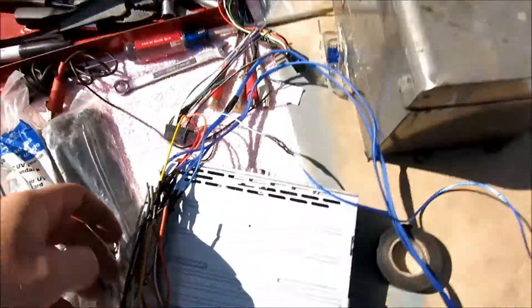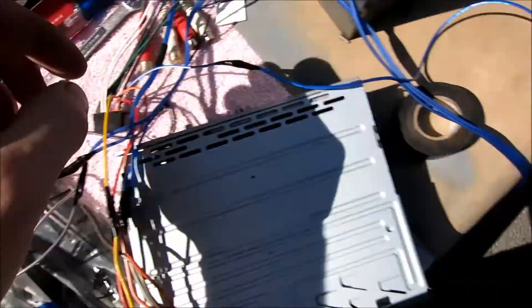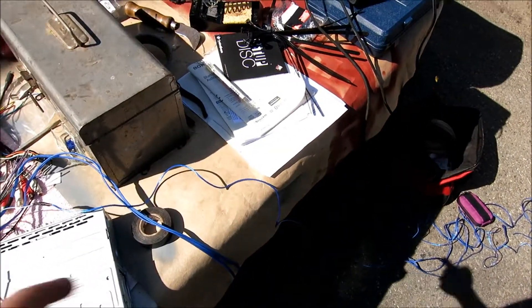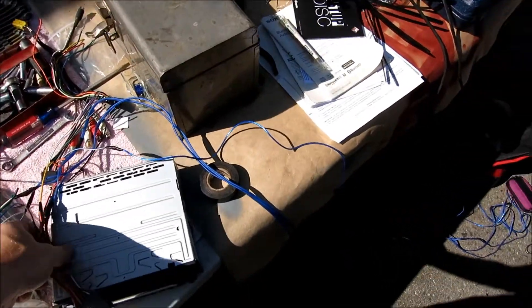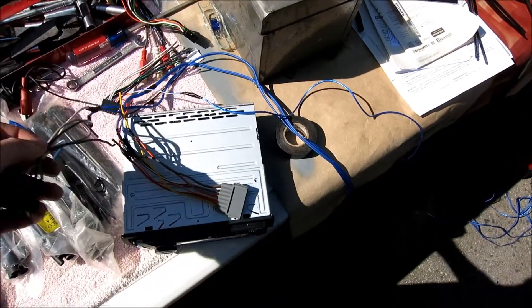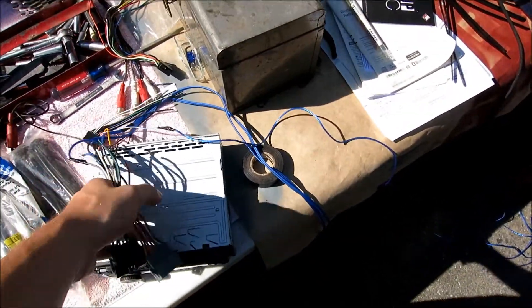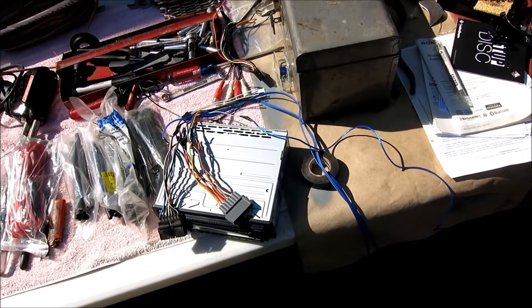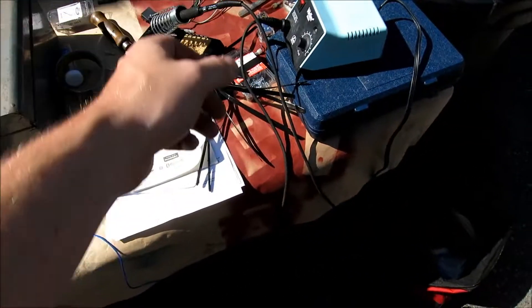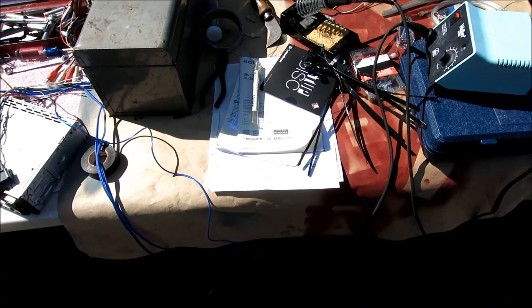Come here and I'll show you the fronts. The front wires are inside the door, so rather than running them through the doors we're just going to run it right from the back. This is the vehicle side of the harness — all the other speaker wires just bundle up. You don't really need much from the deck beyond that. Get your RCAs ready — tape them up and lay out all three pairs. If you're hooking up a sub you'll have three pairs total.